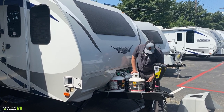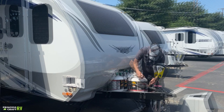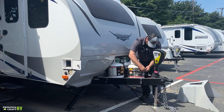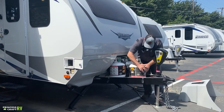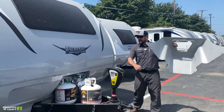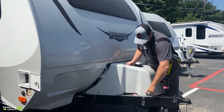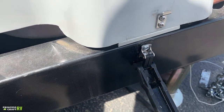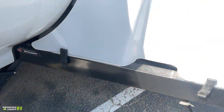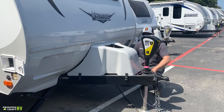The extra storage cylinder is held in with a band clamp — just undo the buckle. When putting it back, fish it in and snap it back down. Then put the cover back on by fishing it in from the side so the plastic rides into the aluminum tracks, and buckle it back on. Don't forget to do this — these covers will blow off and are very expensive to replace.